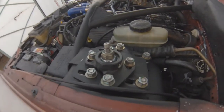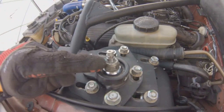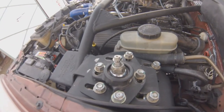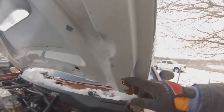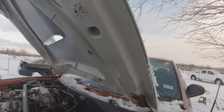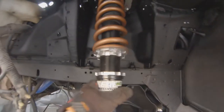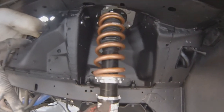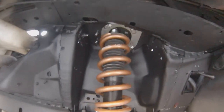There's no thread sticking out — you can see there's the little notch right there and it's pretty much level with the top of the nut. That's all you get sticking out. With the adjusters on there you may have to put a thin washer between the hood and the hinge so it doesn't contact there, though it's usually not a problem. I pretty much set these where there were — no slack in the spring, so at full droop there's no slack.